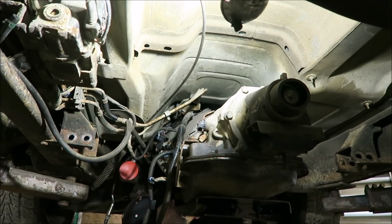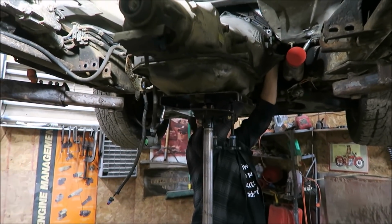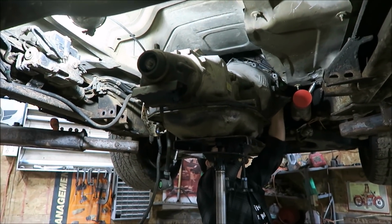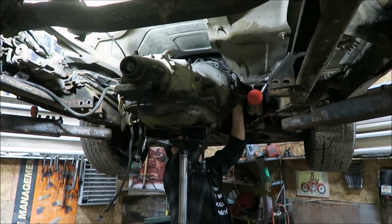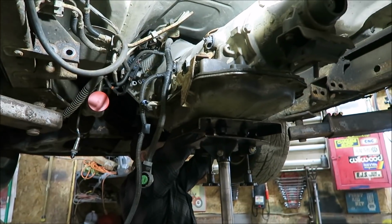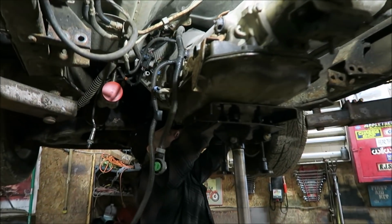And then he already jumped ahead, got the drive shaft out and the transmission pulled. I was bored. I don't know if we're gonna have time today to actually get the truck completely back together and drive it, but we'll get a good chunk of it back together. And then if not today, in the next video, we'll hopefully get it on the road and see how the 4L80 compares to the 60E, how it feels. I'm really curious how the first gear is gonna feel, going from a 3.06 first to a 2.48 first. It's a whole lot taller first gear, so I have no idea how it's gonna feel. But with that 3000 stall, we'll see.